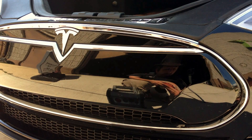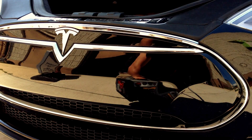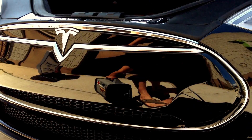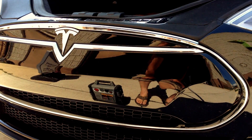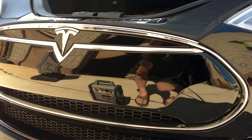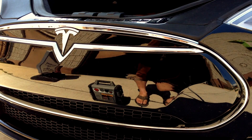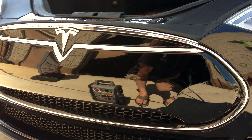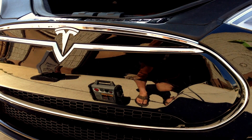You can use a 12-volt battery charger, something commonly called a jump box, which is a 12-volt battery with jumper cables. You can also use jumper cables and jump it off of an internal combustion vehicle, although if you do that, I recommend not having the ICE vehicle started. It should not take much power from that vehicle to get your Tesla back up and running — it just has to sense that the voltage is high enough. And if it does drain that battery, chances are that battery is already failing in the ICE vehicle.